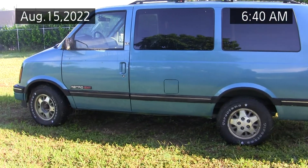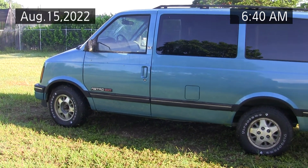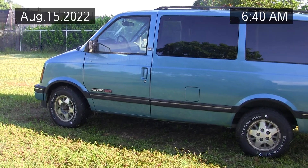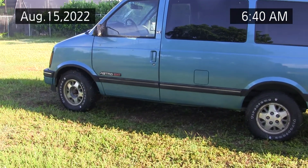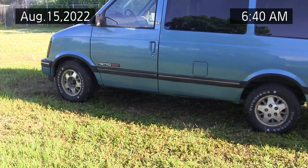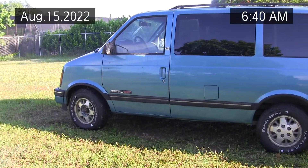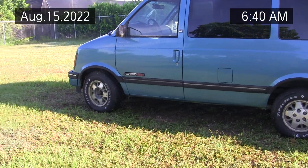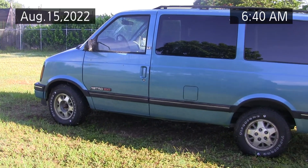Today's video log — I think I got the power steering leak fixed. The lip seal that was leaking on the hydro boost, I think I got that repaired, and the AC seems to be working pretty good. I still have a can short on fully charging it, but I want to do more work on the AC before I say that's finished. I want to replace the accumulator before I say that's finished.